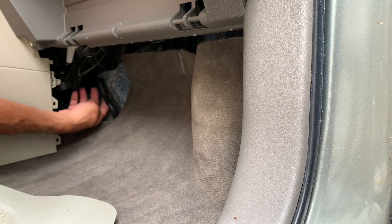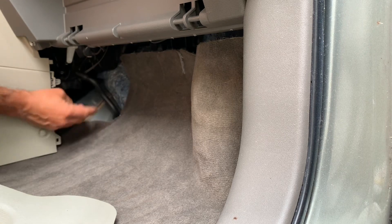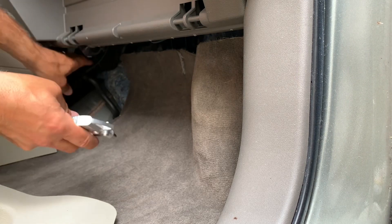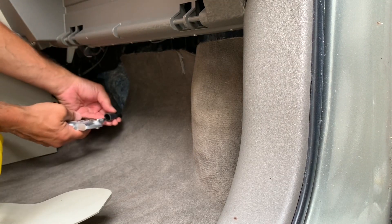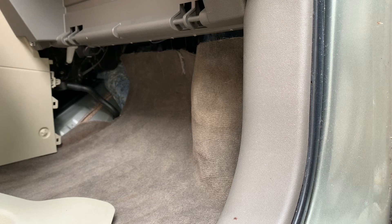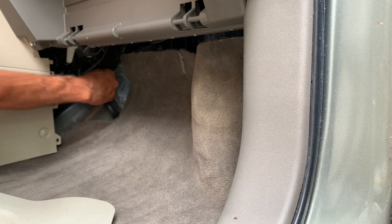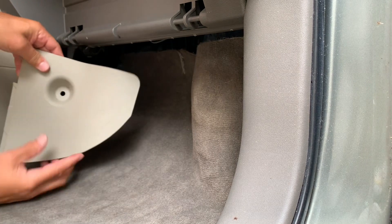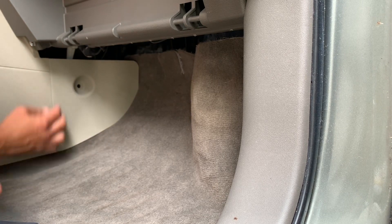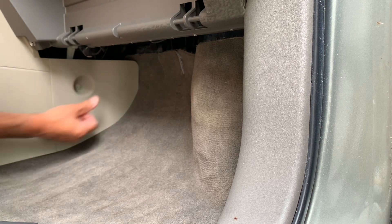The drain line is right here. You can pull it off of the box, and then my new process is using compressed air and simply blowing — and it's clear. Then put it back together. Put it on the spigot, put the panel in place, line it up, and push the retainer clip back in the hole. That's it.